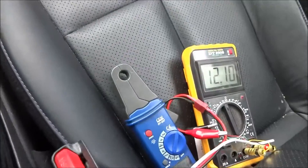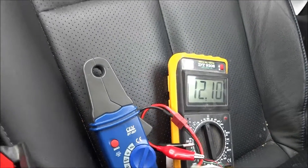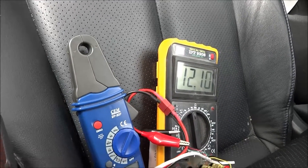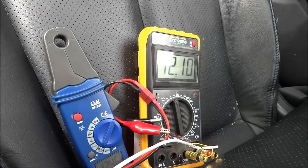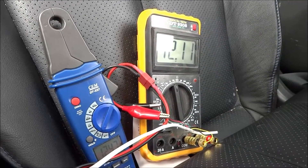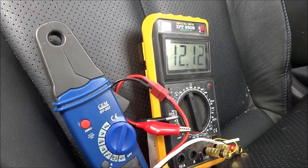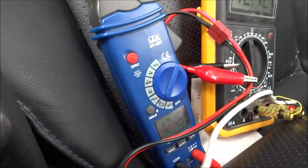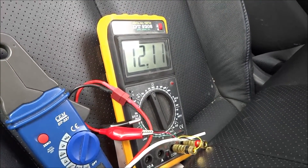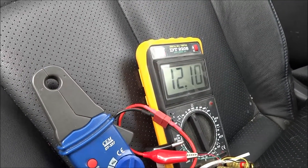I've been in residential areas and I guess because of the wind on the highway, the turbulence keeps the temperatures a little cooler. I've been doing a lot of jack-rabbit stop-and-go, and this is about the warmest I've been able to get it — 12.11 kilohms. Remember, as this value drops the temperature is actually higher. The other one's at 12.46, and they're slowly going back up. I think this is a positive result.